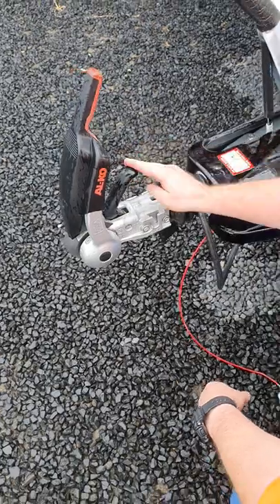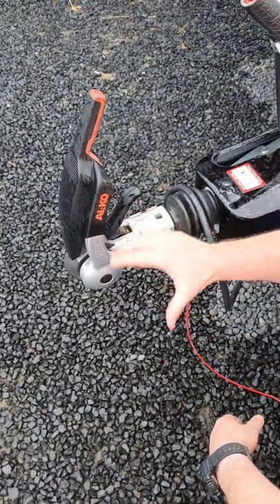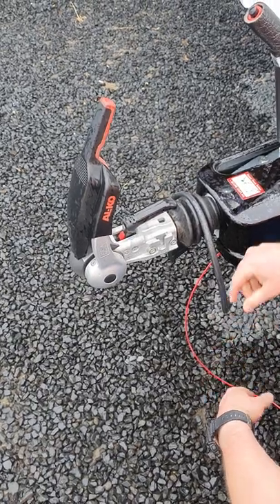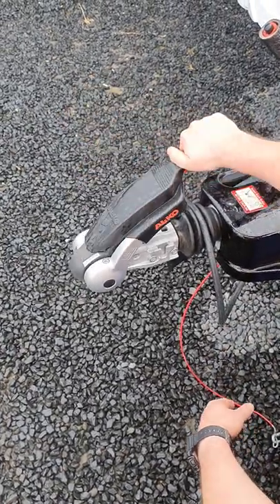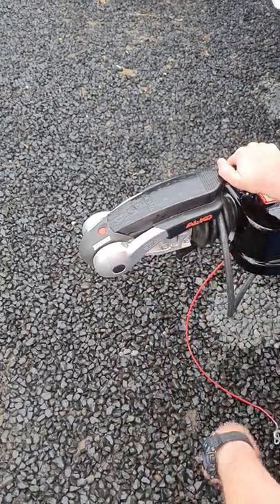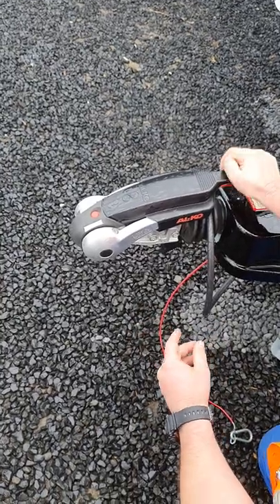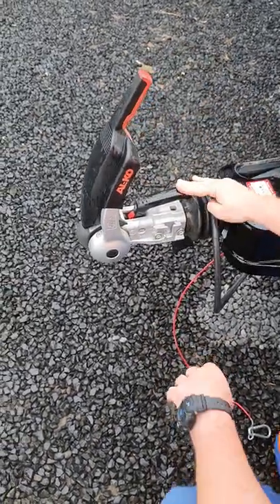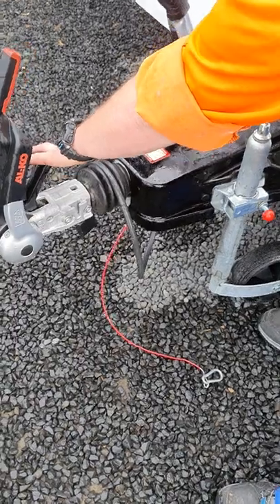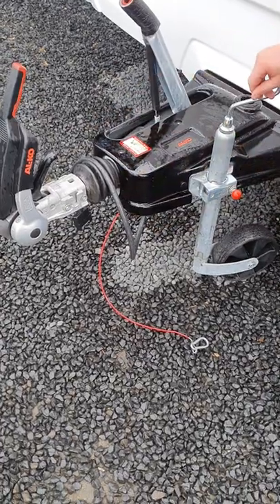Your main hitch here — this little black lever, if you push it up it'll stay up while it's off the vehicle. As you lower it onto the tow ball, it will lock down like that so you know that it's on the vehicle properly. Then you have your secondary lock, so that pushes down over top. This little red button here will actually pop up a little bit and you should get a little green ring around the edge — that just lets you know that it's on there properly. When it comes time to take it off, lift this lock up. You then have to lift and hold this lever, and as you're holding it up, use your jockey wheel to lift it off the vehicle. Once it's off the vehicle, that will stay up.